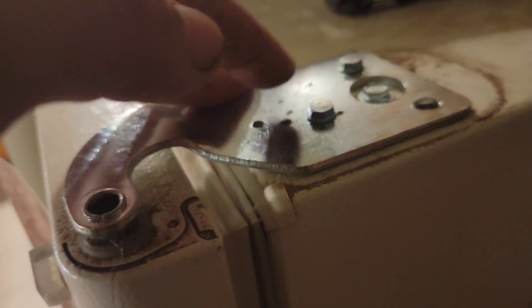They're worn out. There's an eight millimeter screw right here in the corner — pull it out, pull the cap off, and then pull the eight millimeter bolts that are here. Make sure your door and everything is cleaned out on the inside so it's lighter. Once you pull this bracket off, this whole door literally slides right up and off.